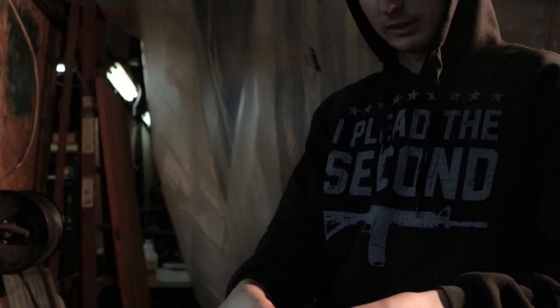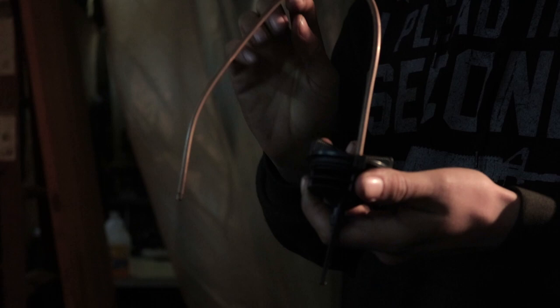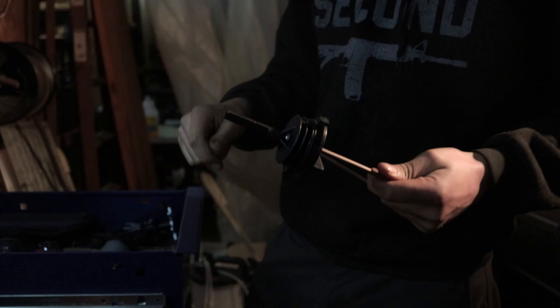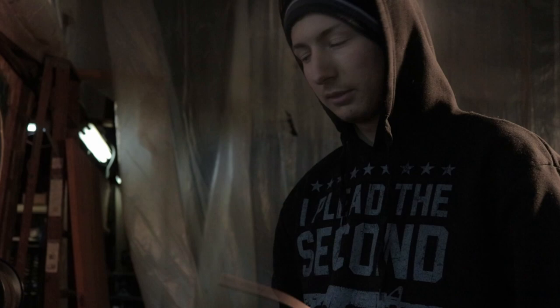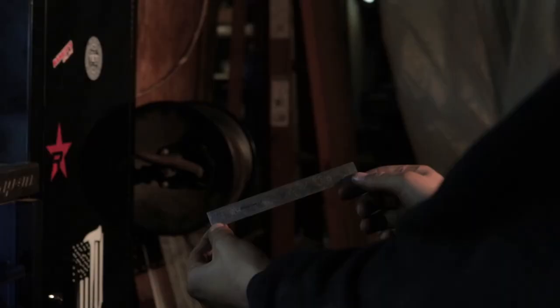This right here is a specialty tool — completely specialty. It's a Ford power steering cap, and then you hook this — I flared a brake line on it — and you hook this to your intake, and it pushes all the excess air into your intake and bleeds out your power steering system on a Ford. Like 7.3s have that, I think some of the older Ford Tauruses have that setup. I do have this though: Snap-on ruler — it was free. I did not buy that, but it is Snap-on.